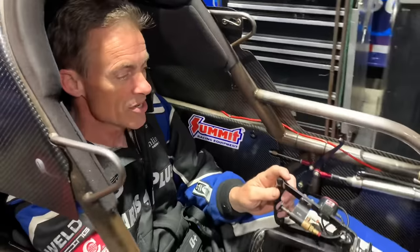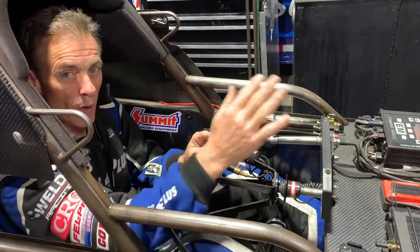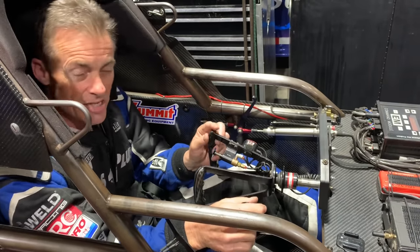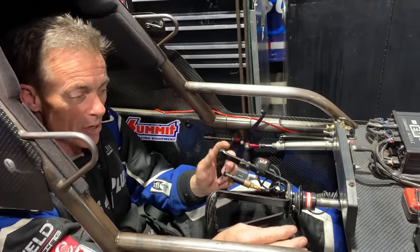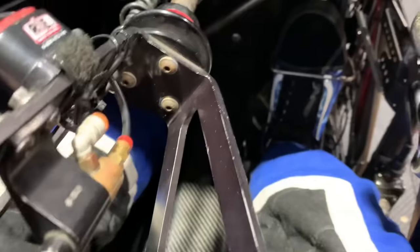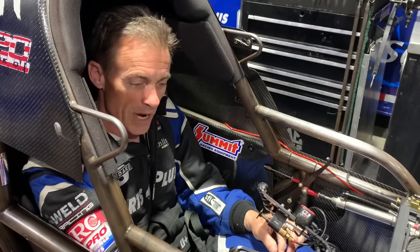Once they're done, the crew chief will run past me, and at that point I will start to let the clutch off and the brake — I just start taking my foot off the clutch. I don't dump it, I don't do it real fast, but it allows the car to start rolling forward. You'll roll through the water box area. The crew chief will then make a motion, and I will hit the throttle. I don't use a throttle stop — you literally just barely crack the throttle open. It's just a very small movement for the big, massive burnouts. I just kind of have an idea of how far I want to go on the burnout, trying to do the same thing every time because it's very important for not only engine temperature but also clutch temperature. I do my burnout, step off the throttle, push the clutch back in and I'm in neutral, let the car roll a little bit, then grab the brakes and stop.